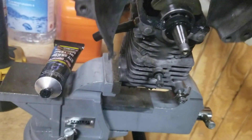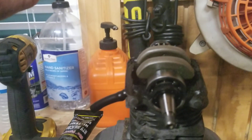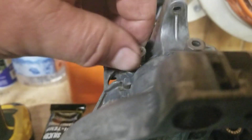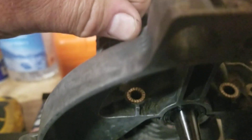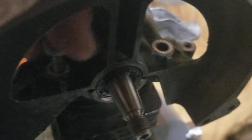Got a little bit of transfer — looks like I'm gonna be really good. We're gonna have a good transfer; I don't have it on too thick. Now I'm gonna take it and make sure you got all the right screws, starting with your fingers. These are easy to cross-thread — remember, everything's aluminum, so you'll cross-thread these like it's nothing. You got to make sure you got them started one or two threads.